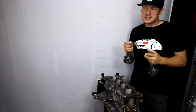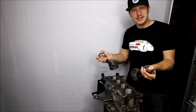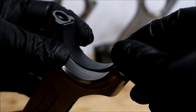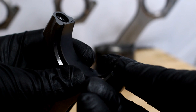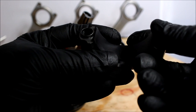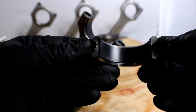What's up guys, my name is Greg Peters, you're watching the Car Passion Channel. Today I'm gonna be putting these bearings in here after making sure that the rod and the back of the bearing are completely spotless. They get installed just the same way that we put the bearings in the block, and same with the cap — no lube behind the bearings on these, you want to go ahead and put those in dry.